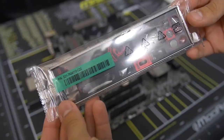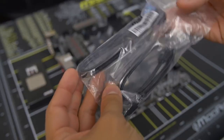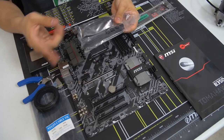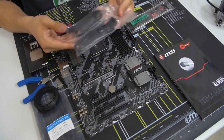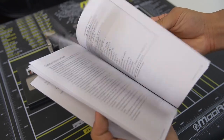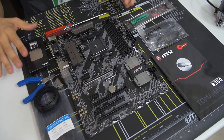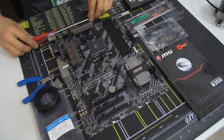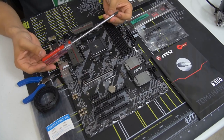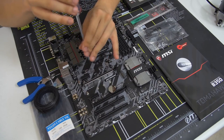When you take your motherboard out of its box, you want to also take out a few important accessories: your motherboard IO shield, your SATA cables — I would take out a number equivalent to the number of 2.5 or 3.5 inch drives you'll be connecting — and your motherboard manual, which you might need to consult at some point. The only tool you absolutely need is a number two Phillips head screwdriver. A slightly longer one is generally preferred, and a magnetic tip also helps a lot — not required, but definitely appreciated.